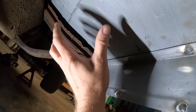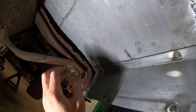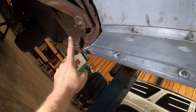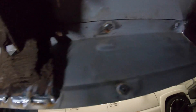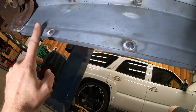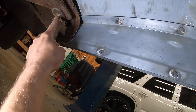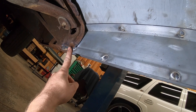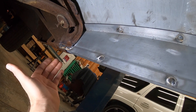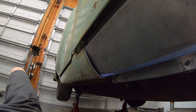The rocker needs to be welded to this, and the floor is actually supposed to touch this piece. There's actually a piece of old floor pan still here. These floor pans weren't meant to fit this vehicle either, so I'm kind of winging it as I go, hoping that I get it structurally sound enough, but this is actually really solid. We're welded here, here, and here. This is a piece of the old rocker. When I had the rocker lined up on the outside, on the inside there was a gap coming up to the body mount section of the frame. I had to pull this in, and in turn that changed how the rocker lines up.